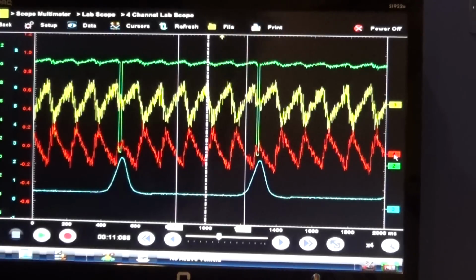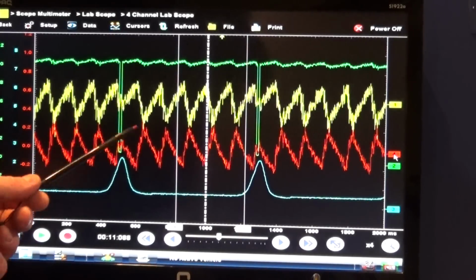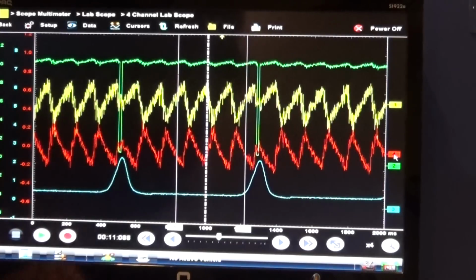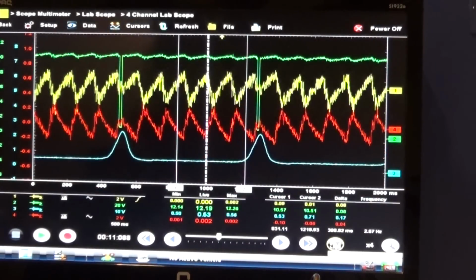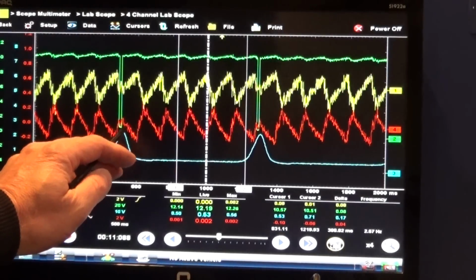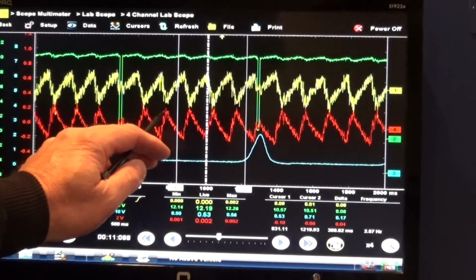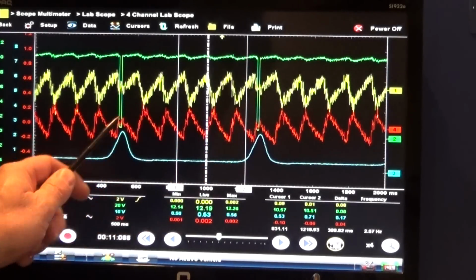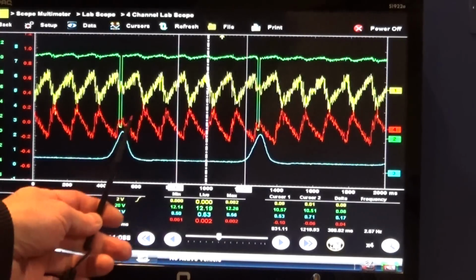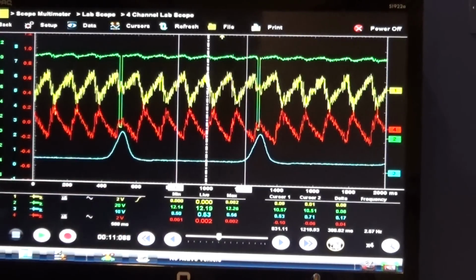Okay. All right, so it's almost identical signal from the low current clamp to the high current clamp, actually a little cleaner than the high current clamp. So again, we can see the same reading, basically the same pattern, and so we got 2, 3, 4, 5, 6, and 1. So if you don't have a high current clamp, we can use the low current clamp to do the relative compression as well.